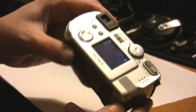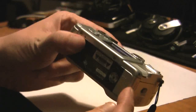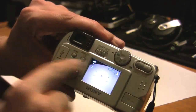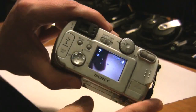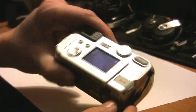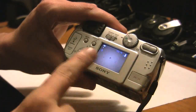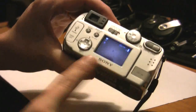If you've got an older or newer Sony camera and you're getting that format error, put the card in, go into your menu system — wherever it might be on your version or model — and go in and format the card. That should take care of any problems you're having. Just remember: you cannot format these cards on your Mac or PC to be used with the camera. It has to be formatted by the camera itself.